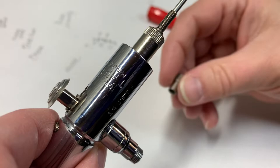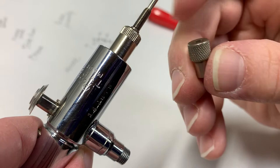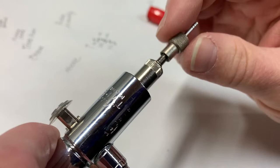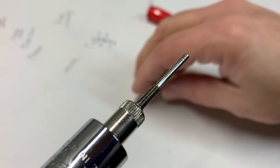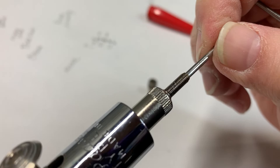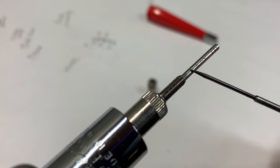What are we missing? We're missing the locknut. This is an older locknut — none of my VLs have these, or maybe it's from a different airbrush. So that just goes right there. Now how does this locknut work? There is a split in these threads — do you see the line down the middle of those threads? When you put this locknut on, it tightens this around your needle so that the needle stays in place.